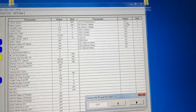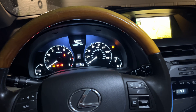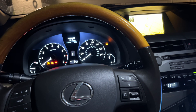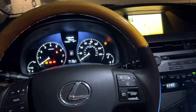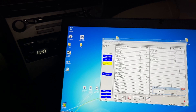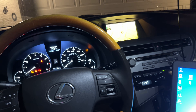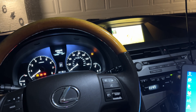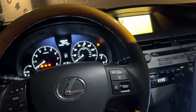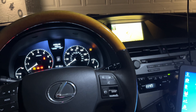The infrared camera shows a lower reading for obvious reasons: when you are outside, some of that heat transferred through the pan and the metal gets dissipated into the air and cooled off. Because the reading is lower, the level measurement you're trying to catch will be inaccurate — it'll be less. Since transmission fluid expands with temperature, you may not even notice a difference, but over the long run you'll probably cause more damage and wear out your transmission much sooner than you should.